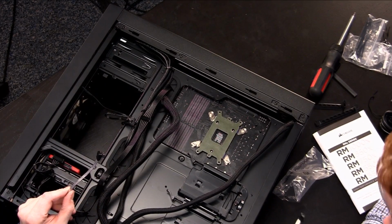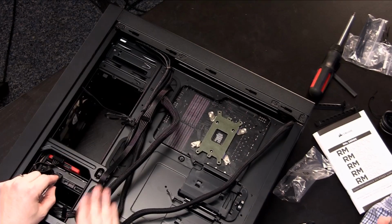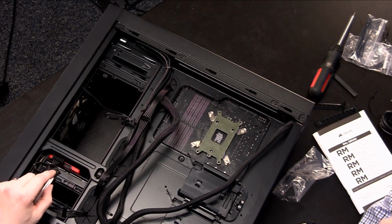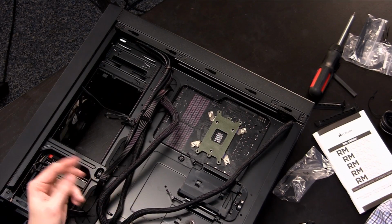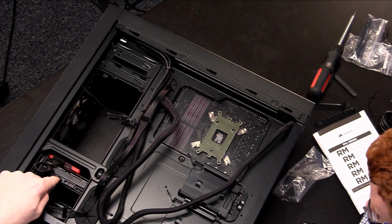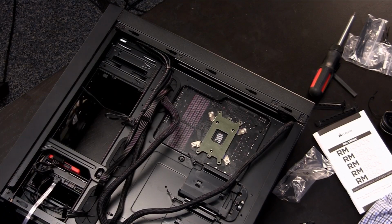Right? So this is more beneficial for installing on this surface because it's at a right angle, and so it kind of automatically comes down. Now the connector at the other end of that same cable is straight, so that when you plug it into the motherboard, it works correctly. So we'll go ahead and install one SATA cable, just like that, into the hard drive, and then we'll use another right-angled one here as well.